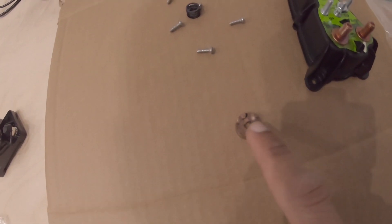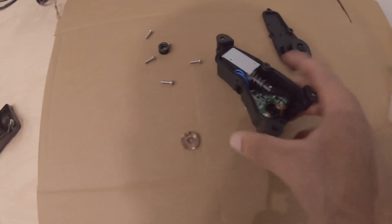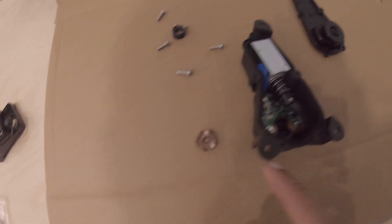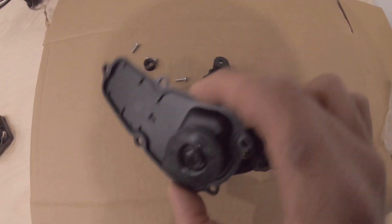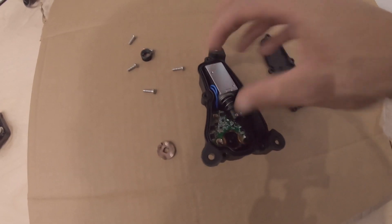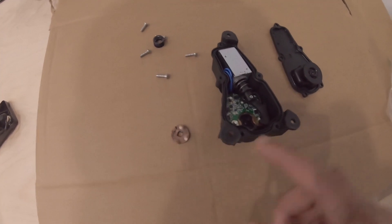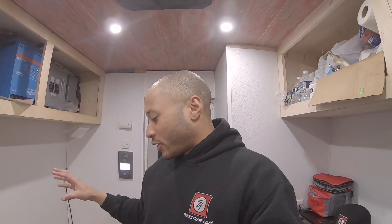Inside the old isolator there's a plastic piece that held things together — a little copper washer that would sit on there, and a little square plastic piece that would rotate whenever it got actuated. That little square plastic piece got hot, melted, and broke. So it just wasn't making contact. It still clicks like it's trying to do its action, but it just isn't connecting — it's broken.